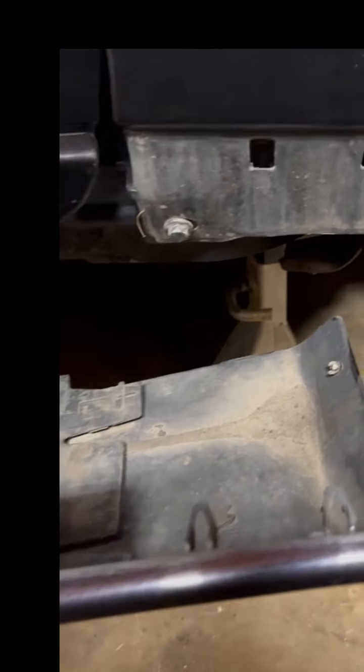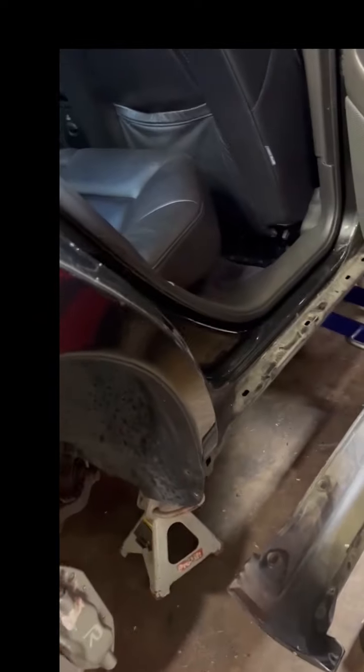Here we are at the front of the car. I've slipped the factory side skirt off, and again you can see the two nice mounting spots — the new sport kit won't use those; it'll just use the two rivets and the clips on the bottom. Time to put it on. If you'd like, clean up the door sills really well. You'll only be using one clip point between the front door and one between the rear door. If you'd like to secure the sport kit a bit more, clean the surface well, add a couple pieces of double-sided tape, and it's good to go. I'm going to clean it up, use the double-sided tape like I did on the other side, seal it up, and that's it — that's how the sport kit goes on.